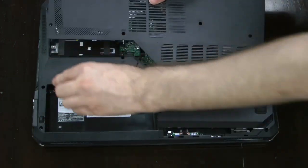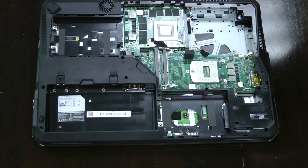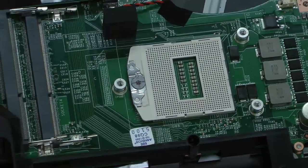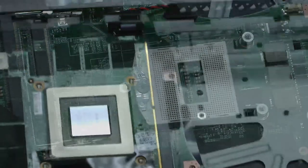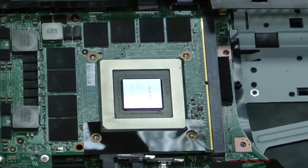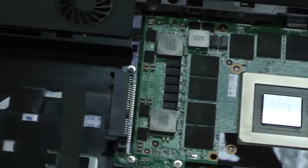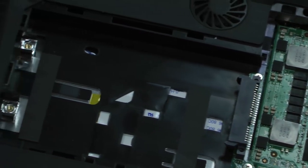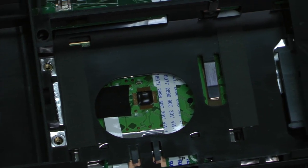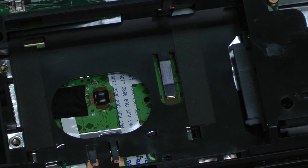There are plastic snaps on all sides, so take care and be patient. On the interior of the 16F4, you can see the CPU socket and two of the four DIMM slots. Above them is the MXM 3.0 card slot that houses the GeForce GTX 880M. To the left of that is the first of the two 2.5-inch drive bays. Below the CPU socket and memory slots is the second 2.5-inch drive bay.